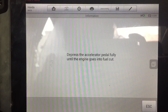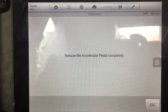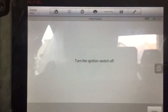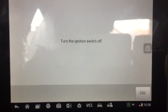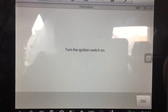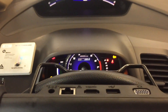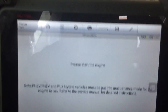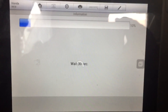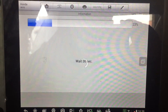We're back — it says release the throttle, so I hit OK. The engine's idling. It says depress the accelerator all the way down until fuel cut, then release the accelerator pedal — just one quick throttle blip. Then turn the ignition switch off, and it's going to prompt me to turn the switch back on. Switch on is when all the dash lights are on. Now we start the engine and let it run while the new CKP position is learned into the ECM.